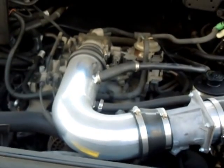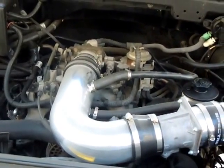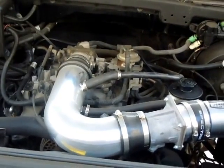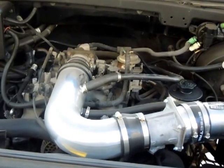Hope that helps. As always, do not change out any part of your cooling system after the engine has been used. System's hot. If you pop that thing open, it'll shoot steam all over you and burn your hands off. Only work on this when the engine is absolutely cold and has been off for a while. Hope that helps you. Bye.